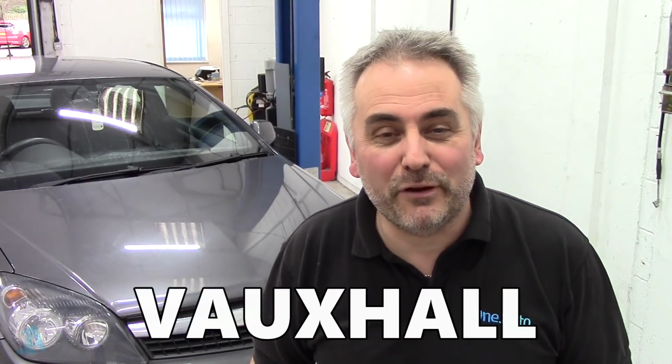This one here behind me, a Vauxhall Astra H 2009. We've got some play in the ball joint. We're going to change a complete track control arm.